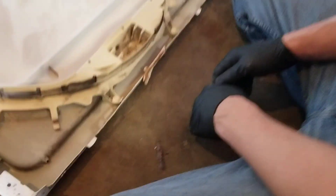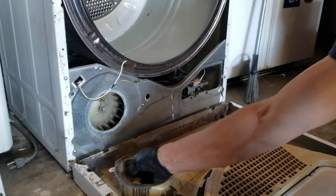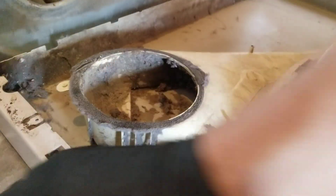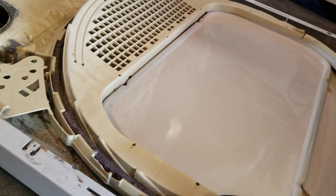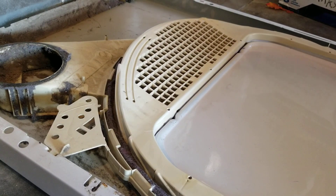Check this felt pad — the drum sits inside this. If you look here, there are these little pads; I need to get new ones because they started shredding from the whole drum coming off. It's important to always clean out the lint on the front because all this debris is from lint going down inside and collecting. Always clean your lint tray because eventually it'll clog up and get in here.